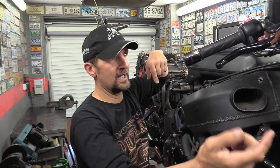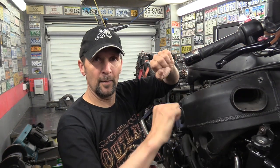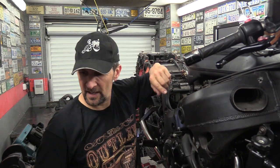So, cables. First thing is, release the clips that hold all the cabling in place so that you can actually get to them and move them around, and then release all the tension off the shrouds so you can actually unhook the ends. That's an easy job.